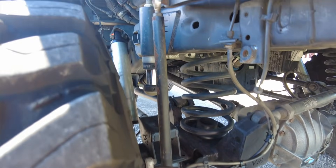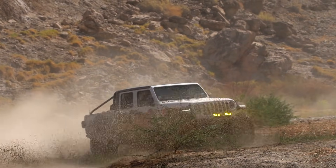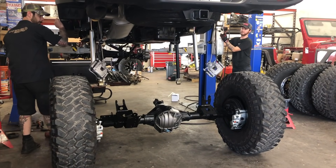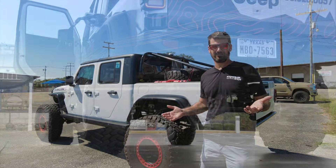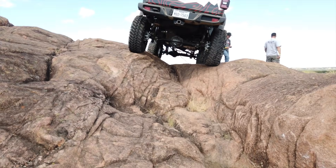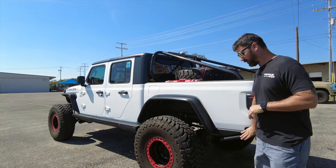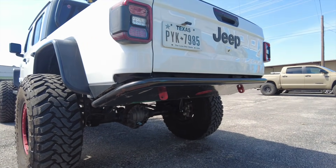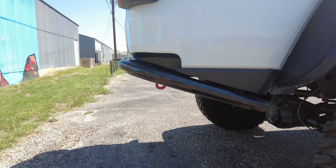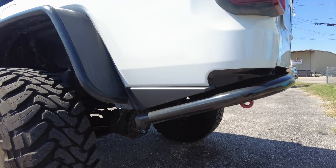For the rear suspension, it's not a coilover — it's what Evo calls their Fusion Kit: a four-and-a-half-inch coil spring paired with King 2.5-inch piggyback shocks. They held up pretty well in Baja, though by end of day I could feel them fading. I'd probably go with a bigger shock next time. We also built our own rear sway bar — Rock Jock came out with one shortly after, which was easier to install. One of the most-asked-about things is the rear skid bumper delete. We were developing a 35-gallon tank to go in the rear and a trailing arm setup, but a lot of that never happened because of COVID.